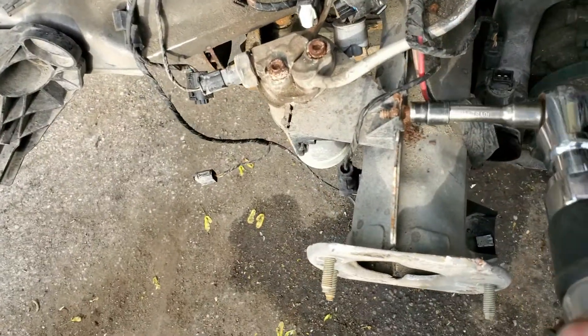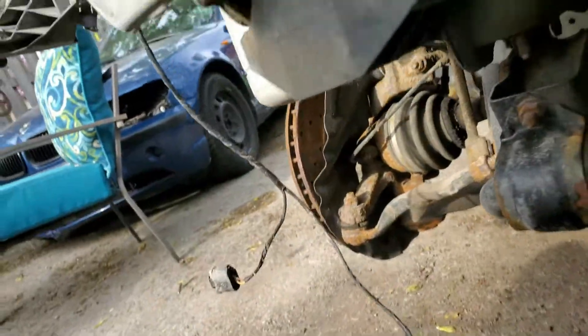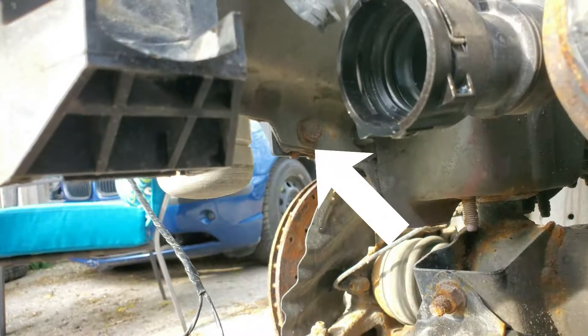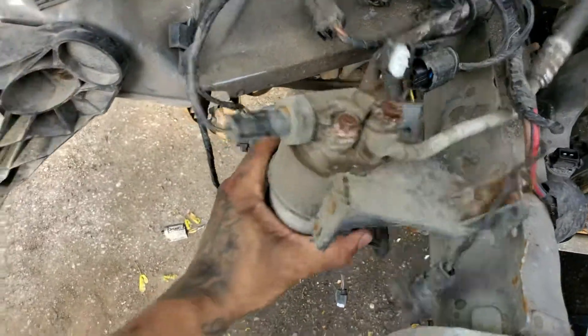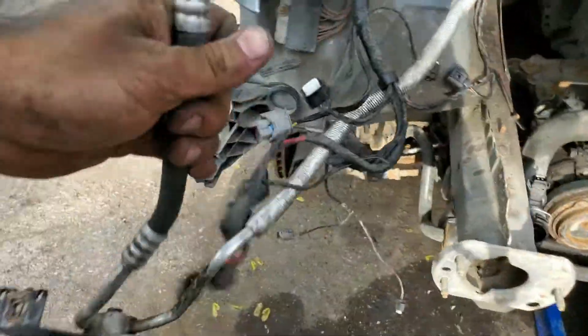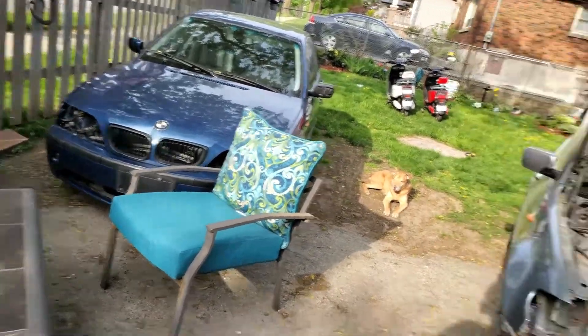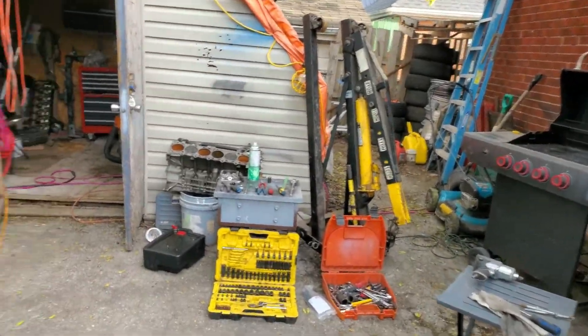There's a super rusty 10 mil right there, and underneath there's another 10 mil. This thing can just pop off - take that sensor off and then this whole thing is free to come loose. We'll save this for later when we reinstall the AC. I twisted it a bit too much but we'll see - I have another one I can use from another car.